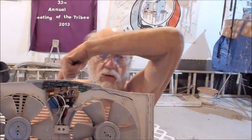Now, once upon a time, a long time ago, you had to use a transformer to do power conversions. If you went from 120 to 30 volts, 49 volts, or whatever, you had a transformer involved there that stepped it down from 120 volts AC to, say, 9 volts AC. And then there was some circuitry which changed it to direct current. I'm not going to explain the difference between alternating current and direct current. They're different, they're not the same. This module up here, first thing it does is get direct current to provide that front panel control board. It's not doing that. Okay.